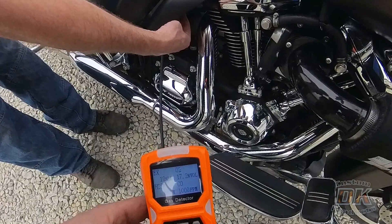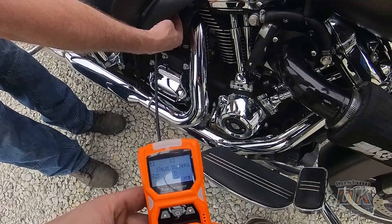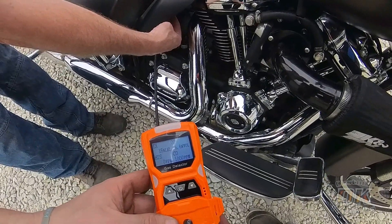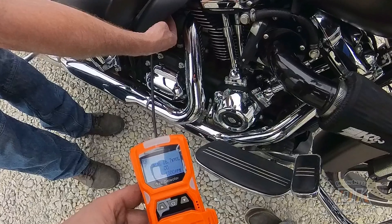And there were zero parts per million of carbon monoxide in the atmosphere, but at the breather output it maxed out the meter. This thing won't measure above a thousand — a thousand parts per million is so dangerous it just tops out and doesn't display higher. That was on the 2020 M8 Road Glide.